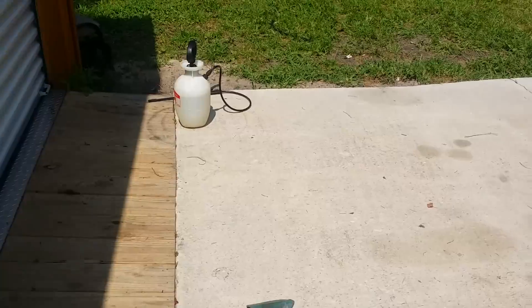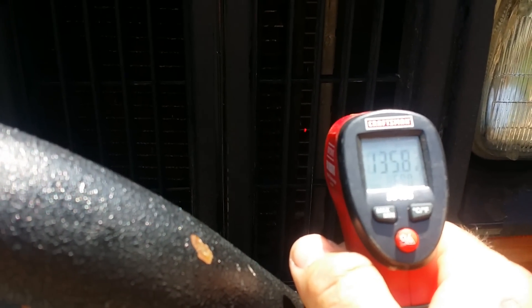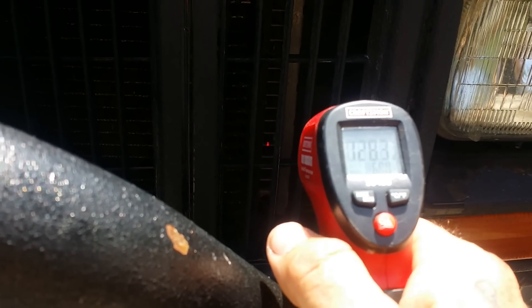It's been running for a few minutes, I think it's up to temp. My thermostat - I cut the valve out on it where it's just got the hole for the 190 to go through it, that way I don't have to worry about it sticking. You see those cores coming through your radiator - every one of them all the way down - your water comes through those spots there. If you take that temp gun: 136, go down to the next one 132, go down the next one 134, 128, then 118, 118, 119 - that's shooting on the cores.